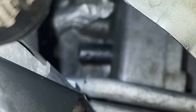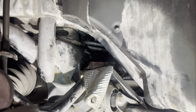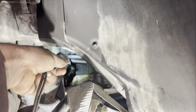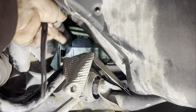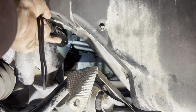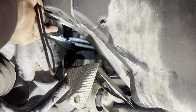With the driver's front wheel removed and the heat shield peeled back, I was able to gain access to the torque converter bolts. You can see my socket right there — the black sticking out. The workshop manual showed coming in from a different way, but I could not get any torque with all my extensions that far out. What I ended up doing was having my socket wrench extending right through here, lying on my back underneath the car, reaching my arm up and pushing up. That was the only way I was able to get these bolts out.